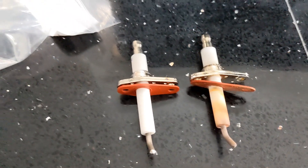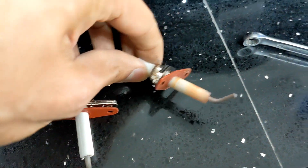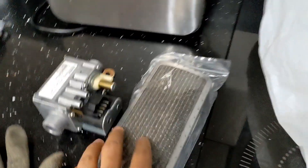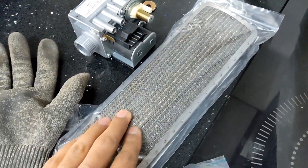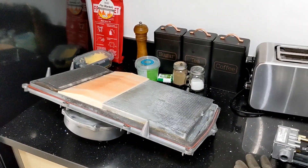So there we have the new electrode and the old one side by side — you can see clearly that one's seen better days. Popping in the new electrode and the new burner — it's not spongy, it's not loose or anything compared to the old one, which is all coming apart. So I'll swap the burner over as well and that should sort our problems out.